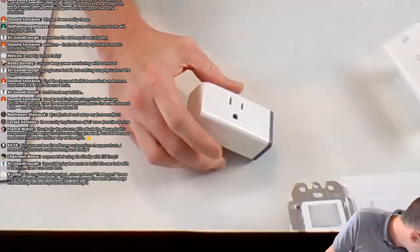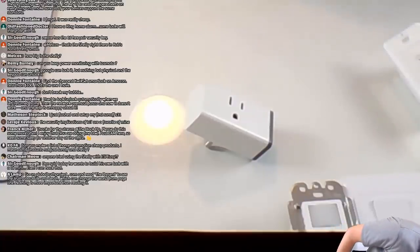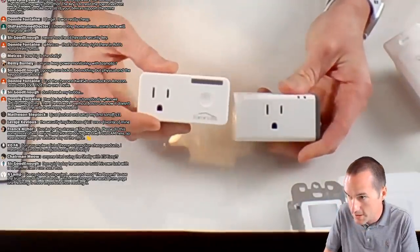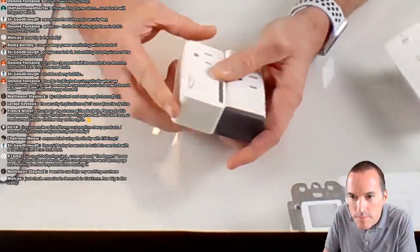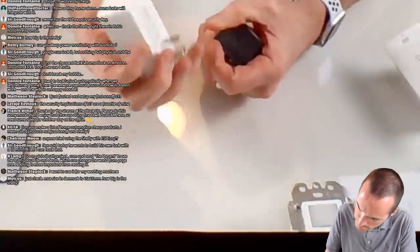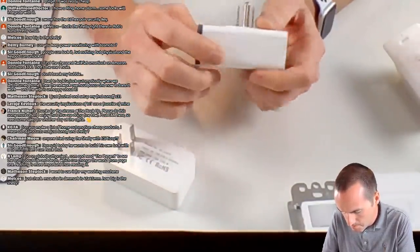Versus the Tuya one that I didn't even have to open up at all. It's basically the exact same switch, right? Except I didn't have to open this one at all because I did it with Tuya Convert, and it was $14.99 for 4 of them, and this is like $16 for 1. I think these are 16 amp too. Yep. Max load 16 amps, 1700 watts. Same as this one.